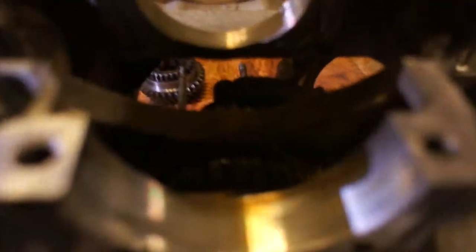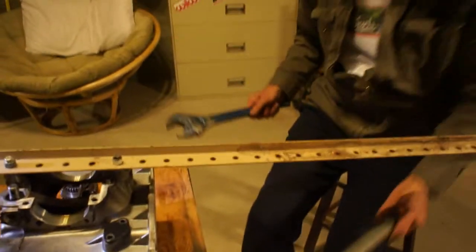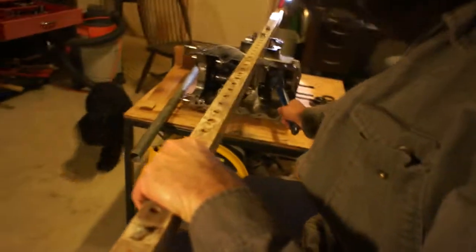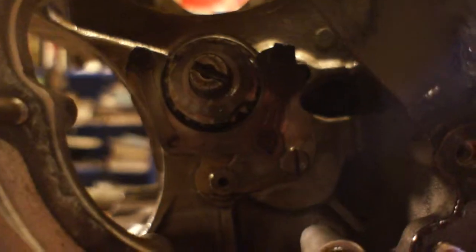There we go. There we go. Where's the pinion nut? It's hard to see because it's underneath here. But that's all we needed — now it's loose enough. I don't even need my big long torque wrenches anymore. You can see here that this gives us just a really good grip on the case so that we can get in here and break that pinion nut. We'll reposition here and finish taking that off.